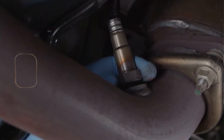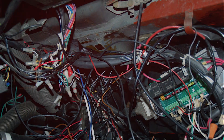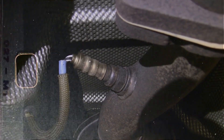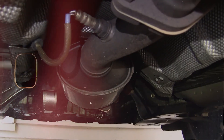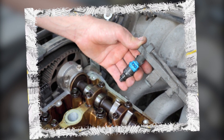So what to check first? Check the wiring and connector near that sensor, usually on the exhaust manifold side of the engine. Damaged or corroded wiring can cause bad signals. Look for exhaust leaks near the sensor too — extra oxygen sneaking in can trick the sensor. If wiring and leaks check out, the sensor itself might be failing; these wear out over time. Also, vacuum leaks around the intake or clogged fuel injectors on bank one can cause a real lean condition, so don't forget those.